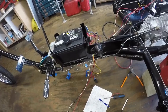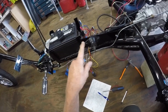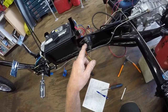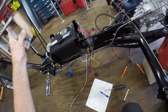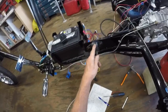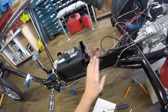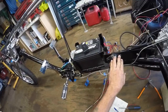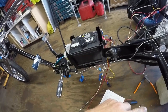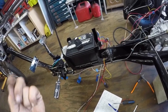The indicator light will be down here by the key switch and light switch. The indicator light should be for when you have the high beams on — the lights are gonna light up just like in your Beetle, so it's mostly there to fill that hole. I also need to run the oil pressure indicator light back to the oil pressure gauge, and I still have to wire in the alternator into the system with its indicator light on the body.